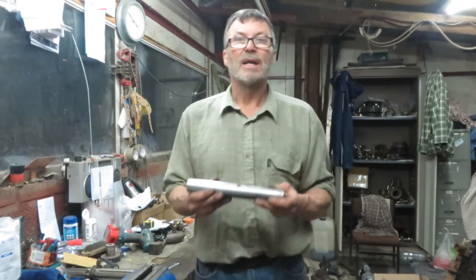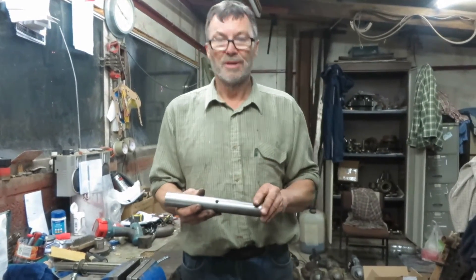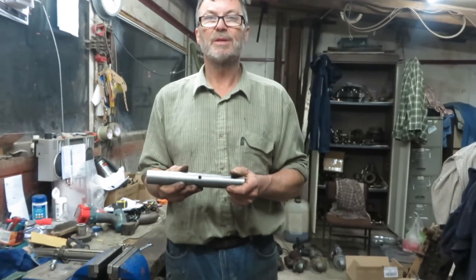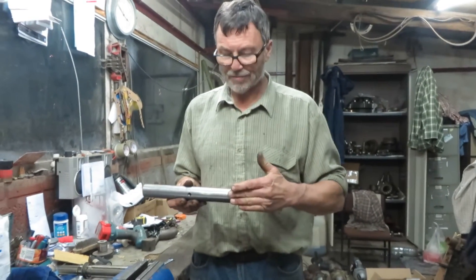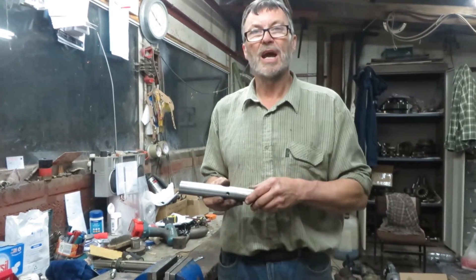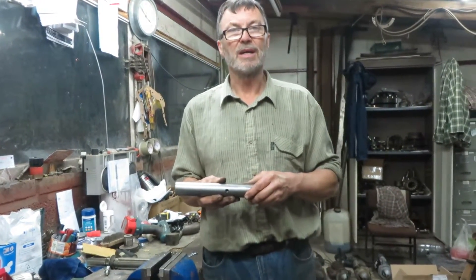Hello, I've been asked by a friend to make a differential pinion setting tool for him and I thought I'd share it all with you. First of all, get about 11 inches of good smooth straight iron bar. It needs to be straight because it's the straightness of the bar when you put it in the gearbox that ensures the accuracy of the measurement you're taking.